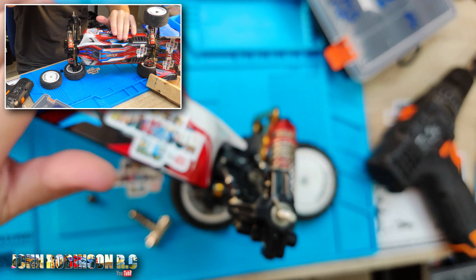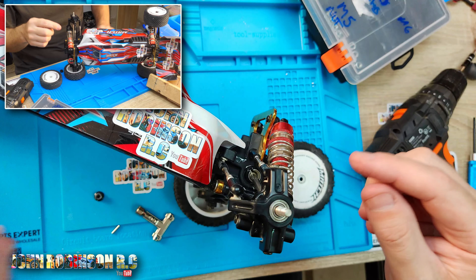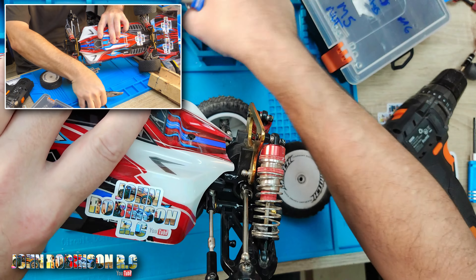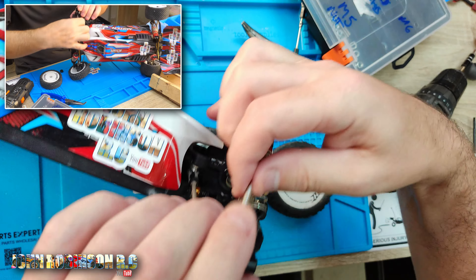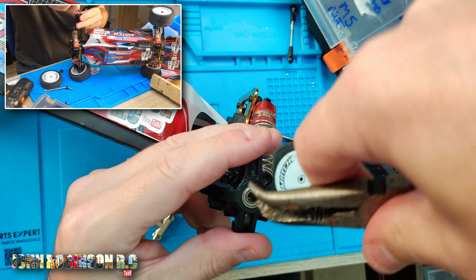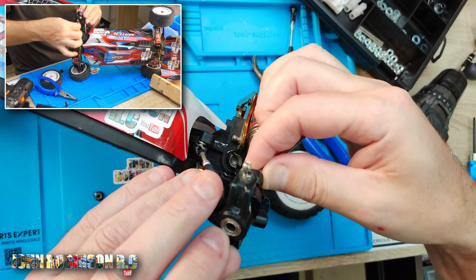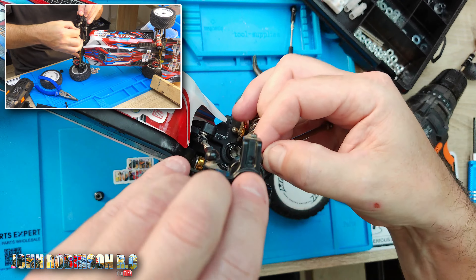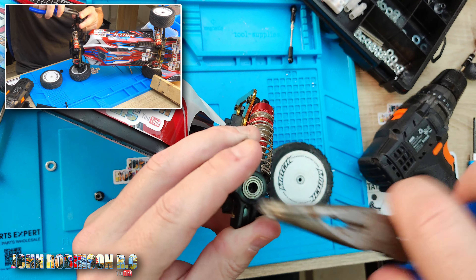So my solution, if you choose to accept it, is: you've got to remove the pin no matter what, and you have to undo this tie rod here, because it just pops off the other end simply. Bring that down because you need to get the driveshaft boot out, which will then allow this to pop out. Now, what we would usually do — and what I did on previous models — is put the washer that side. So now that washer is pressing onto the bearing itself. But if you do this, and again this is only because this is a larger car...